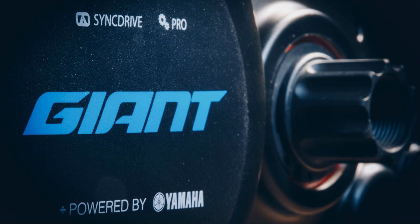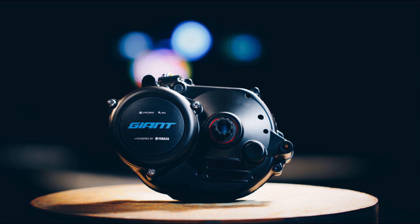But not too long after, the Shimano E8000 was out with an even better motor design. I'm essentially talking about the location of the crank axle. By pulling the axle as far back as possible, bike frames can be designed with shorter chainstays. This was pretty much the only negative I had about the old Giant Sync Drive motor. Unfortunately, this hasn't changed for 2020.